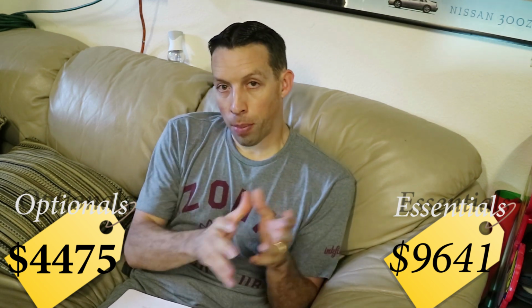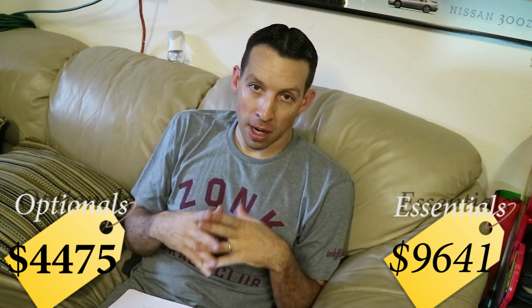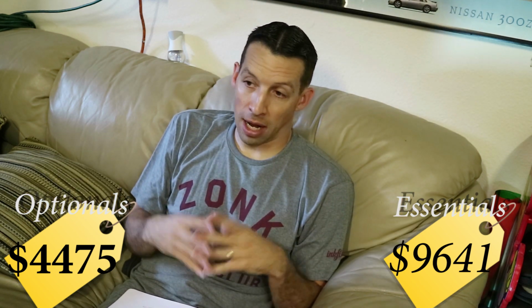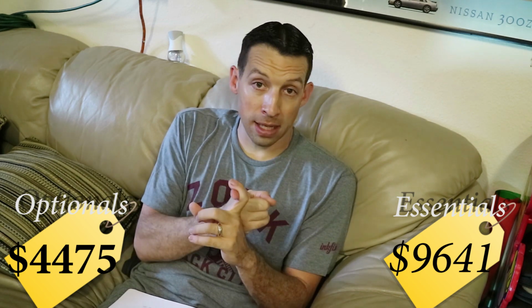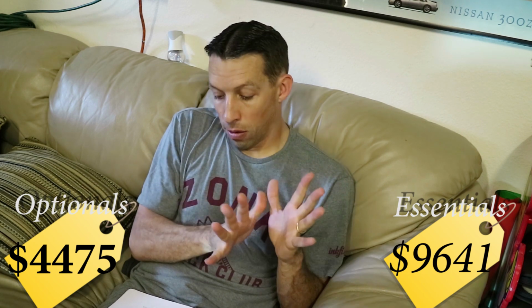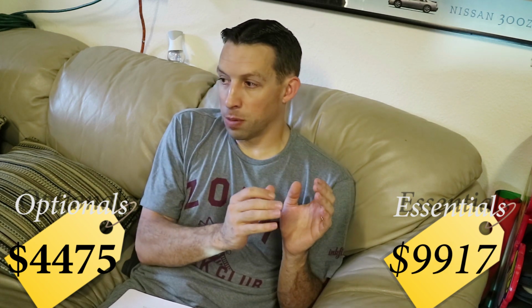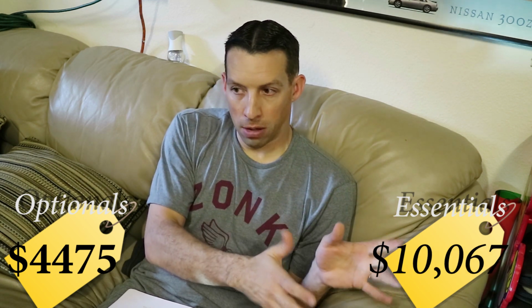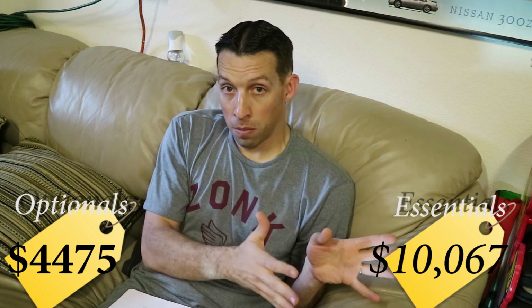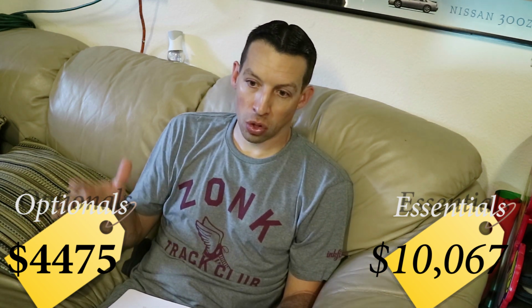Now, when it comes to all the piping in between that Y pipe and the X pipe, I bought all the piping I needed from Summit Racing, and I built my own exhaust. 45-degree bend pipes, flanges, gaskets, an 18-inch resonator, and a Y joiner. All of those parts together were $276. And then I spent another $150 renting a welder to actually put it all together. Doing it myself, I saved a ton of money, and I didn't have to pay for a tow truck or any other stuff to get my car to a place.